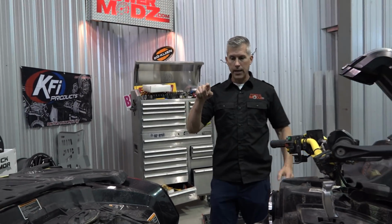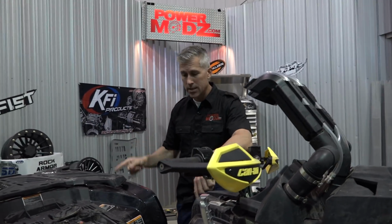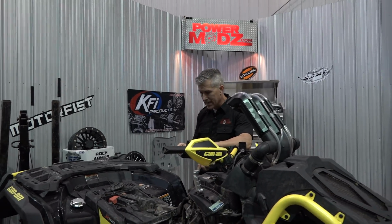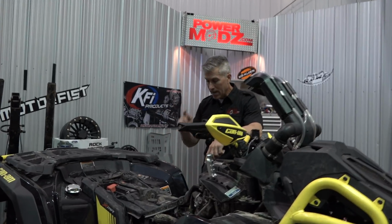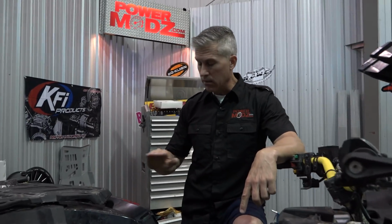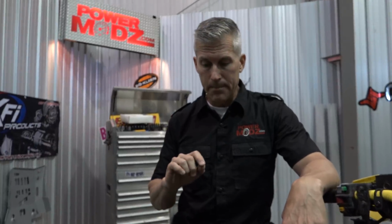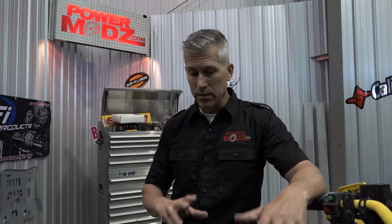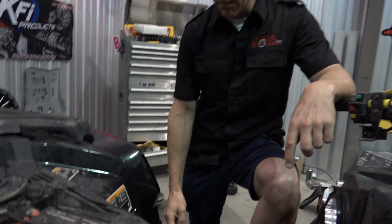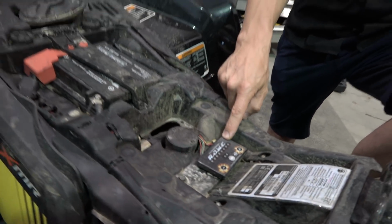Oh yes, we do have the RJWC full exhaust system on it. A lot of guys ask me, do these need a tuner with the exhaust? Highly recommended. We have a tuner on ours, and it just planed it right out, just makes it run a whole lot better. These exhaust systems are quite restrictive when they come from the factory because of emissions and a whole bunch of other stuff. So we put this new system on, it flows a lot more. You need to add more fuel, and you can change it up with this tuner right there. And we've done that. We're going to go to a local dyno shop and hook everything up because it does have the bungs on it, and then we're going to really dial it in.